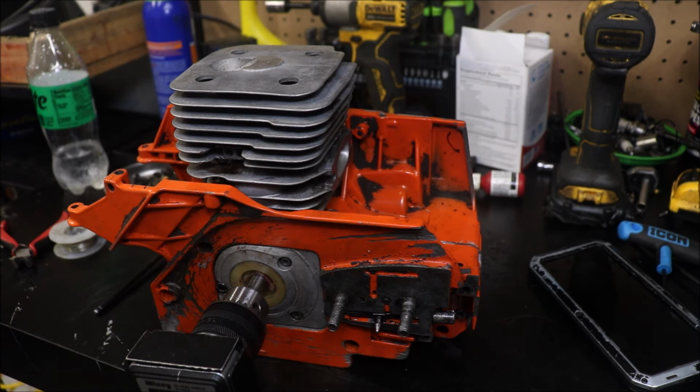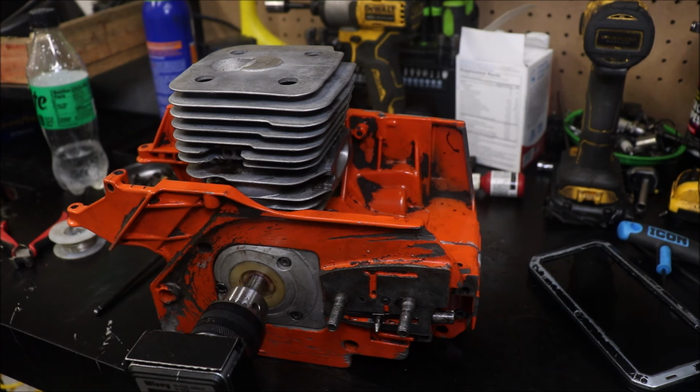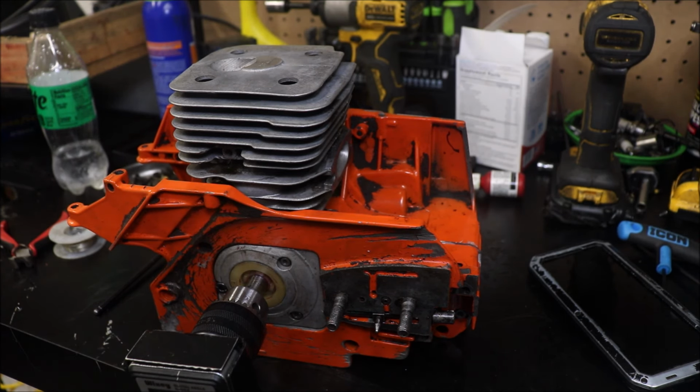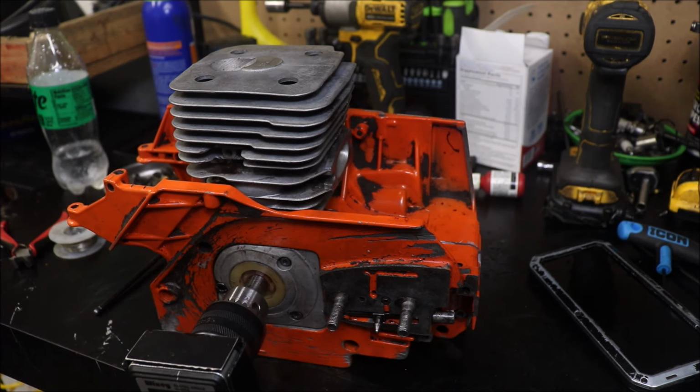That's 18 degrees, 74 and a half on the intake. I did measure complete open to close. It's smack dead on 150 degrees of total open time. So it should be a pretty good boost over where it would have been stock with the base gasket, and should be like daylight to dark difference from where it was when we brought it here. But with that said, I'll try to get a video thrown together.